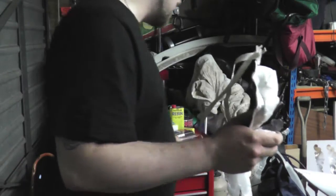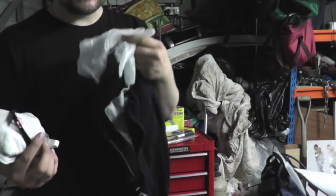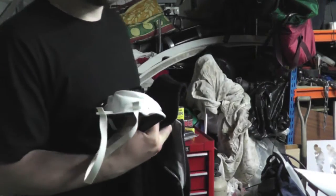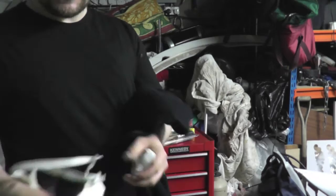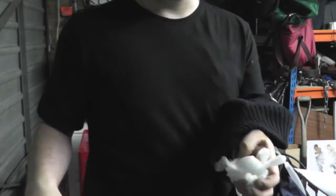And of course, you can see I'm wearing short sleeves now, but I'm going to put on a woolen, woven sort of army long sleeve thing, just to stop the fibres getting in contact with my skin, because it really itches on the elbow and stuff like that. Do not try it without wearing all this. Gloves, you'll end up replacing them quite a lot because they will rip and cut. You wouldn't believe it, but they do cut with glass fibre. So be safe, be seen, act like a dick wearing this. Suppose you want to see me with all this on, don't you? Yeah, good luck.